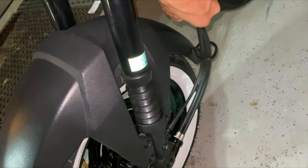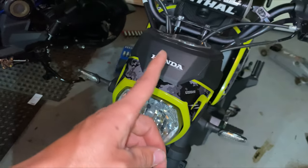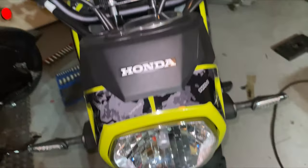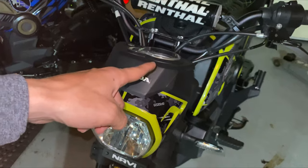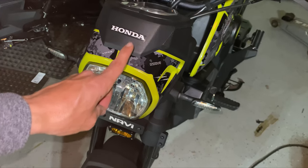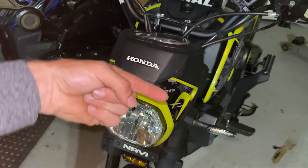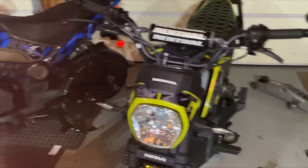What was happening is this cable part was fine — it literally doesn't matter where it runs behind there. The issue was where the speedometer cable comes up and hits that little black crossbar: it was fed around that, so whenever you'd take a turn, even though the speedometer runs off the front wheel and you'd think it stays constant, it was actually stressing the cable. You'd turn right and it would want to come off. With it now going straight down, all it has to do is that simple motion — no fighting around that black crossbar to get down.